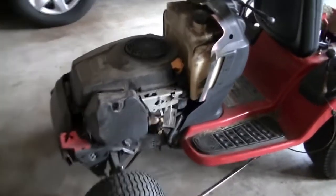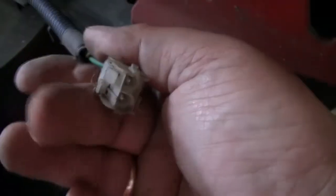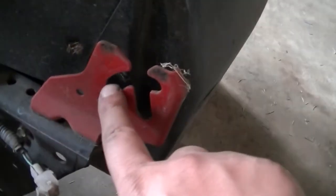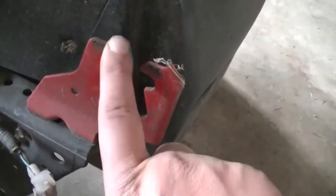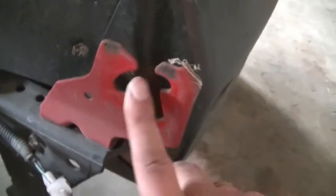So now I removed the cover, which is very easy. I'll just disconnect this one power connector, and then turn the cover towards 45 degree angles, so all the screws get aligned to this, and then just pull it out. So it's the same mechanism on both sides. Very good mechanism, and the whole cover is out.